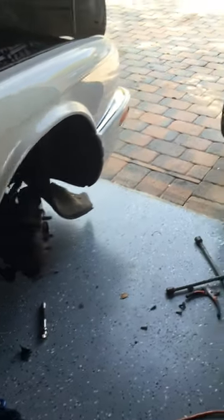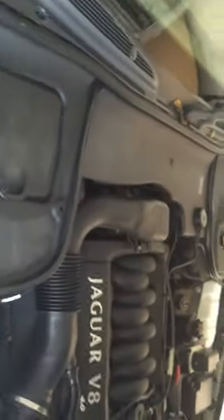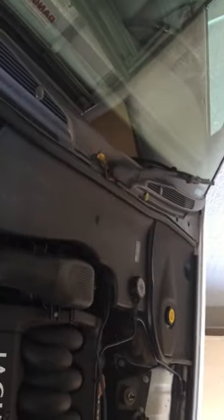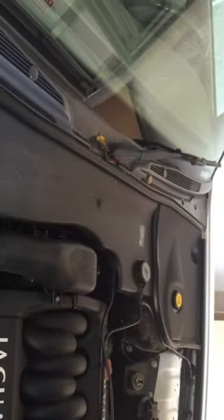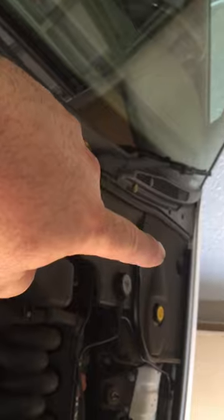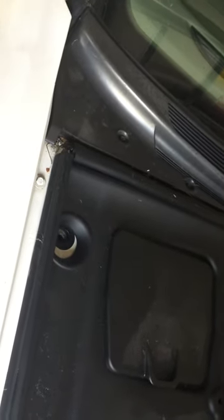Here's a video for people with old Jaguars, from 1999 up to 2003, that still had the reverse hood. One big dilemma is when the hood release cables don't cooperate — you try to open the hood and only one of the latches releases, or none of them do. Normally one will release and the other won't, and you can see them in those little countersunk holes. The biggest problem is there's basically no real emergency procedure to open the hood if the cable gives you problems.